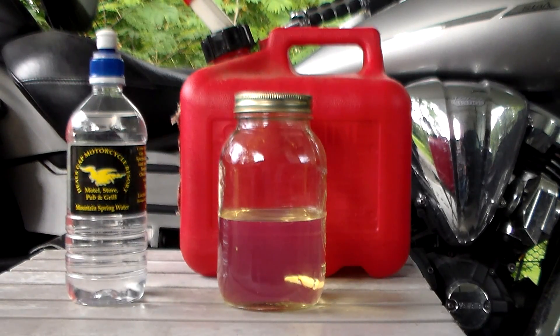I just wanted to let you know why you can't keep ethanol fuel in there. Hopefully this will answer some questions for you. I want to stress that products like Sta-bil and some of the others do help — they will extend the life of the gasoline. But I have not seen one yet that will carry it over about three months through the coldest part of the year. It just can't do it — it actually loses effectiveness over time.